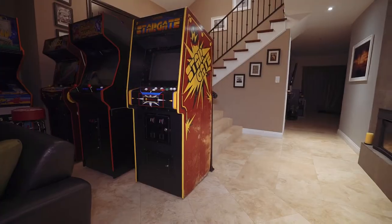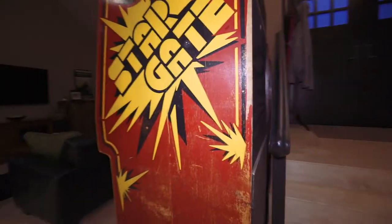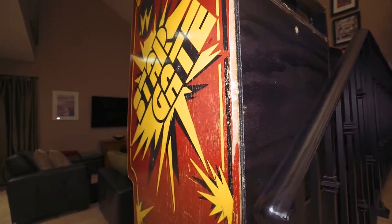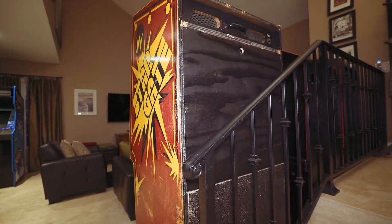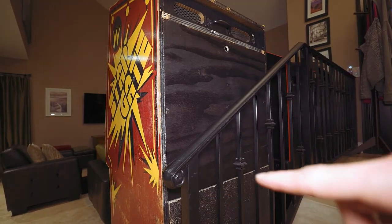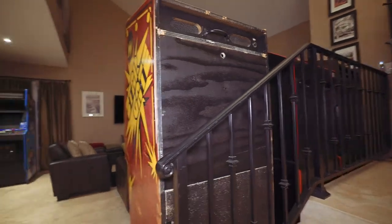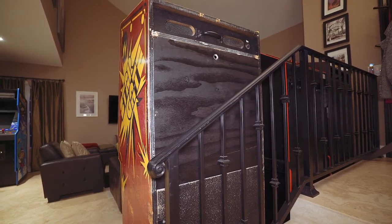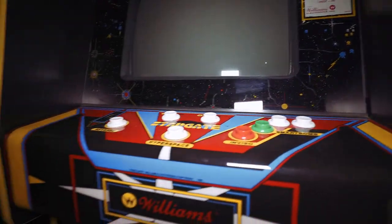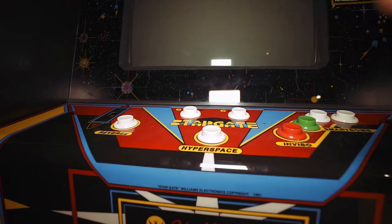I have brought Stargate inside because most everything is done. I did get a piece of wood for the back from Home Depot — though to be honest, I didn't quite buy the right piece. It's not quite thick enough. I had read online it was quarter-inch, but it might need to be three-eighths. Home Depot has two types with the groove already on them so you don't need to router it. I put this one on for now but I may end up replacing it. Also, the missing buttons here — I ended up installing them. It was missing the two player one and player two buttons. I actually had leaf-style buttons from my Jr. Pac-Man dedicated that I wasn't using yet — that cabinet is still waiting on its marquee, bezel, and CPO, going on three months now.